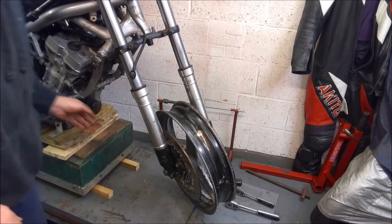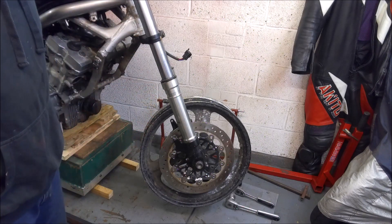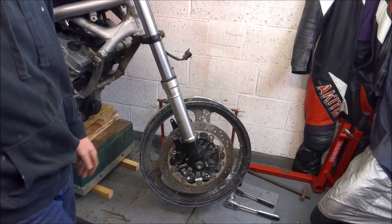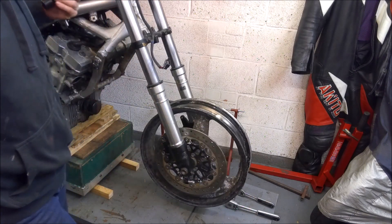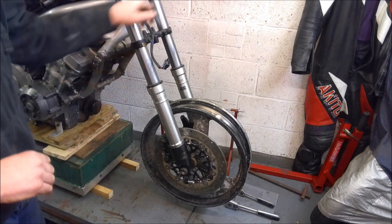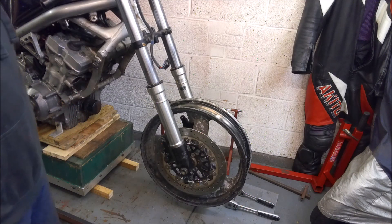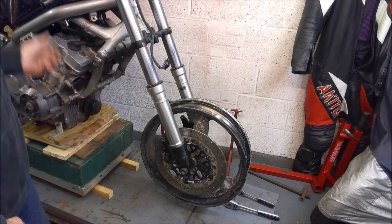That's nice and easy, and this is one of the reasons I went for the Honda Fireblade front end — Honda generally tend to stick to the same dimensions for most of their components. For example, Honda have used the same size head bearings on all sorts of bikes since about the mid-eighties up until really sort of early 2000s. It's the same with the front wheel bearings — they've been the same size on numerous bikes. So I knew the spindle would fit, and of course the ignition barrel — again, same centres for the fittings. As a manufacturer, why would you stock loads of different size bearings for different front wheels when one size can be used on everything?